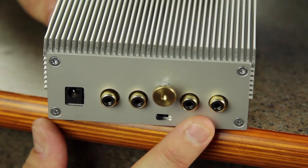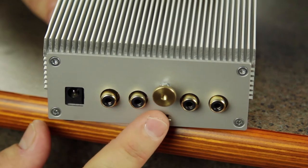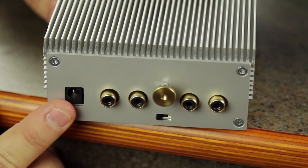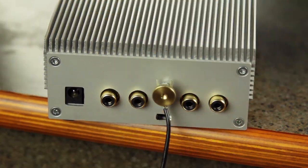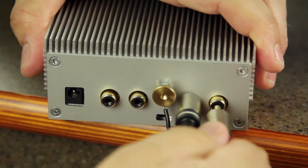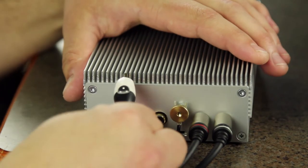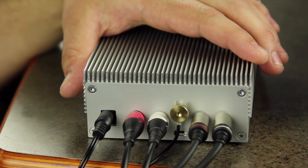On the back, there's a turntable stereo input and a line level stereo input, and an attenuator switch for the line level input, a ground wire connector, and an input for power. I'll connect my ground wire to the ground connector, and I'll float the ground over to the turntable ground to get rid of any hum in the signal. I'll plug in my turntable with a stereo RCA cable, and I'll plug in an additional eighth inch to RCA stereo cable so I can plug in any other auxiliary devices like my phone.